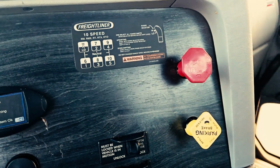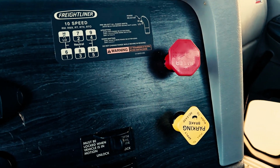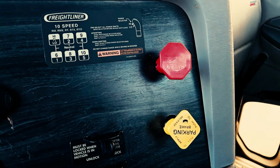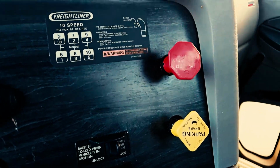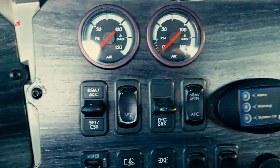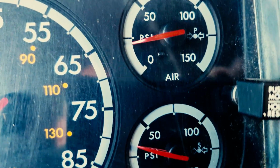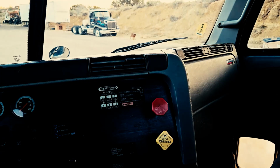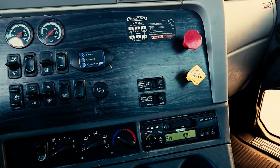Now we're nearing 45, so this is where you watch your valves. And right around 30 psi in most standard vehicles, the valves are going to pop out. Now we're right around 30. There they go. Okay. Now both my parking brake valves have popped out. You take note that they popped out right around 30 psi, which is between the range of 45 to 20 psi, which indicates that this vehicle has passed. So you tell the examiner.